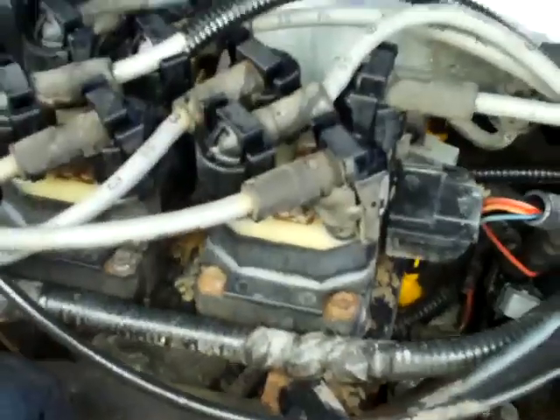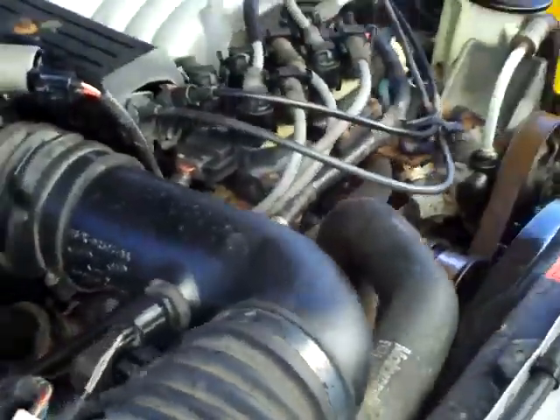Still wouldn't start. I tried adding fuel because it was below a quarter tank, but still wouldn't start. Checked up here to clean the battery cables, clean the coils — you name it. Wouldn't start. Tried starting fluid, wouldn't work.